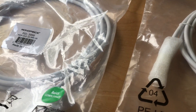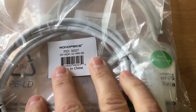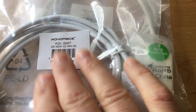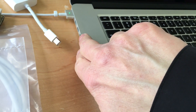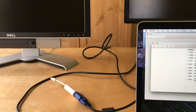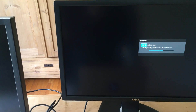That VGA cable is also a six-foot cable. And then finally, I have this last cable — a mini DisplayPort to DisplayPort cable — and we haven't talked about that type of connector yet, but we will in a minute. All these cables: one end plugs into your Mac into the mini DisplayPort Thunderbolt 2 port on the side, and then the other end plugs into the back of your display or monitor. You do need to take a look at the back of your monitor to understand what kind of ports you have, because not every monitor has the same type of port.